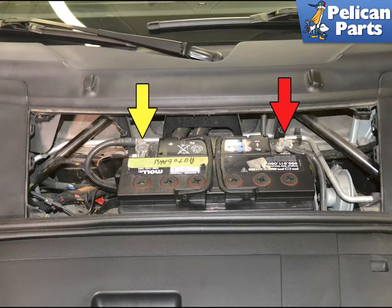If you have a 3.8 liter motor in your Carrera S, there is a tuning flap in the resonance tube. This flap is controlled by a control valve and actuator on the rear of the resonance tube. If you don't have a 3.8 S motor, you do not need to worry about this.